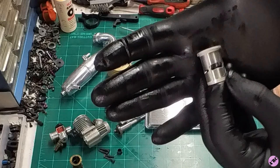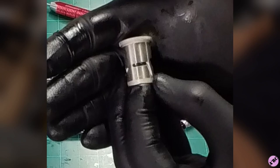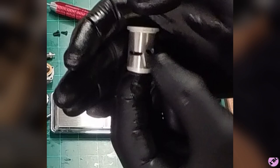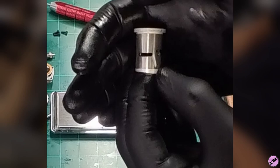Let's talk about this sleeve's features. Here's our exhaust port — we've got some nice big dog ears on the sleeve. Moving to one of the transfer ports, we've got a nice long fang. This is not the modified version, but the standard Team LC already comes with this nice big beveled fang going to the transfer ports on both sides. The boost port has a nice bevel to it as well. The modified versions are reportedly a lot more severe.